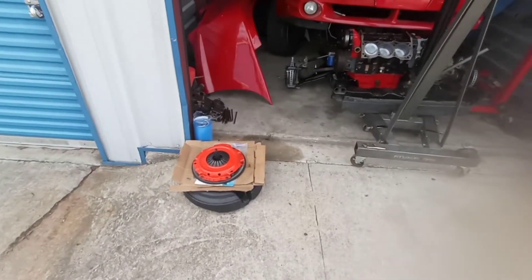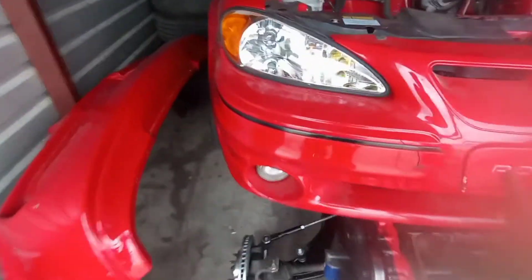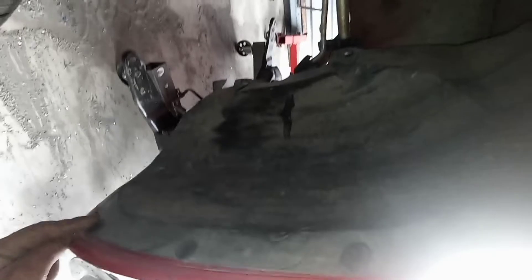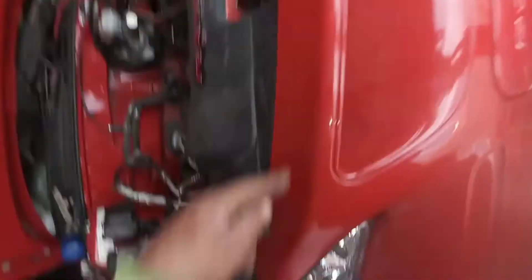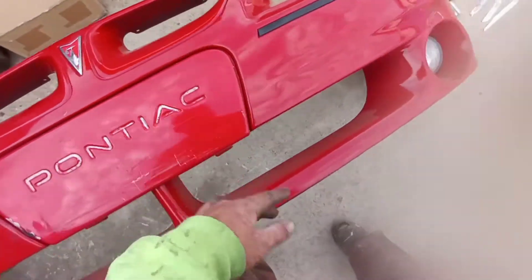It's the next day, Tuesday. I'm over at the Grand Am storage again and I'm gonna try to test fit the bumper. I've got a 10 millimeter up in here on this splash guard and these three tabs — once I undo those on both sides and undo the tabs up top, this bumper should just come right off since I've already taken all the radiator stuff out.